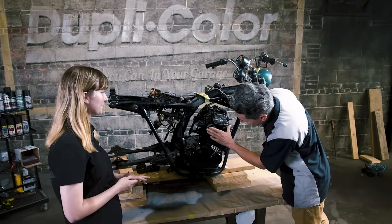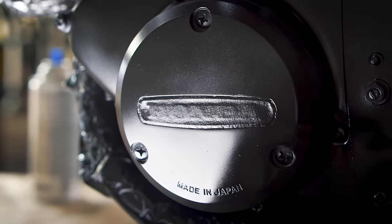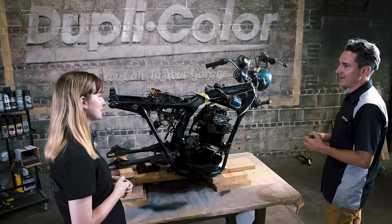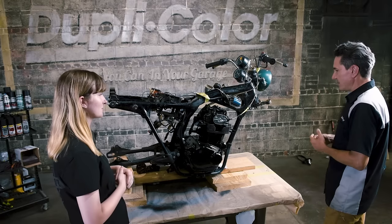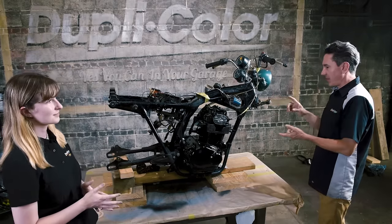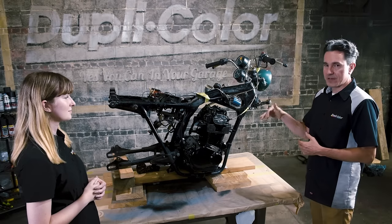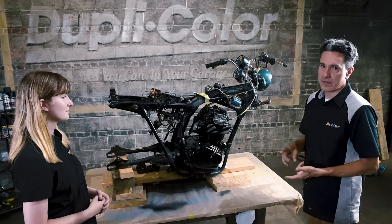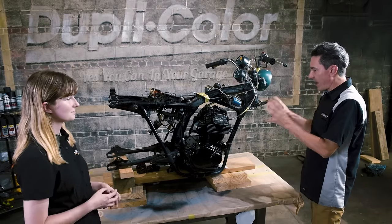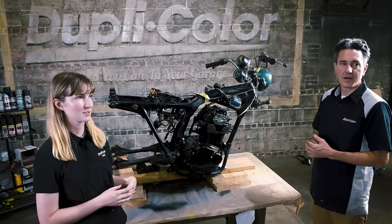The bike is all unwrapped and the engine turned out awesome. There was a lot of prep work but it definitely paid off. For Sophia, this was her first time really tackling a job like this, and she said there's a lot of tedious work that goes into it, but she has a lot more appreciation for those who take on projects like this. It's super time consuming but it all pays off in the end. The engine paint will hold up to high temperatures, oils, and gases — engines run about 200 to 300 degrees and we're rated at 500 degrees, so we're covered. No chipping or flaking either, since we scuffed it down, applied primer, and did a couple of good coats of paint. To learn more about products like this, visit duplicolor.com — and you can actually win this bike, so check out Duplicolor's socials for the sweepstakes!